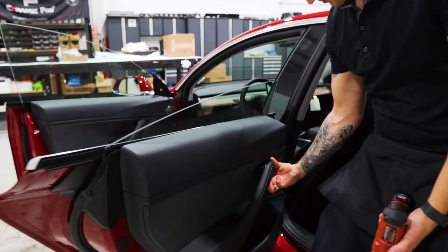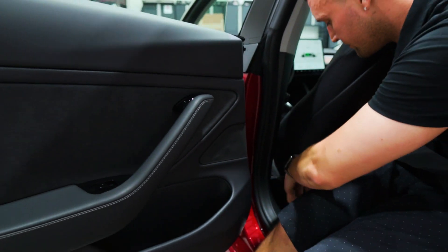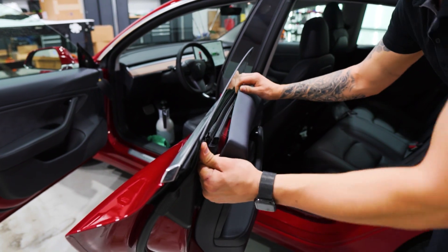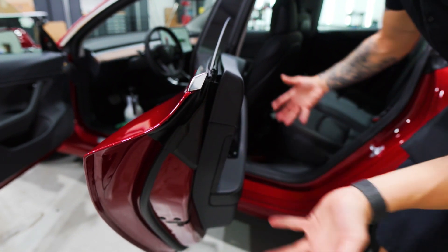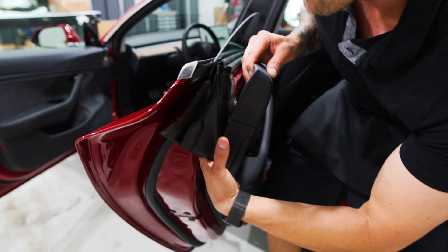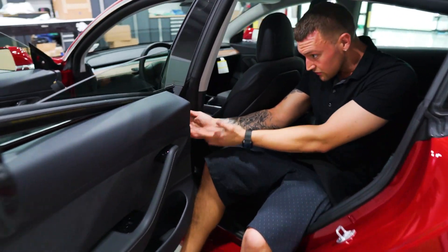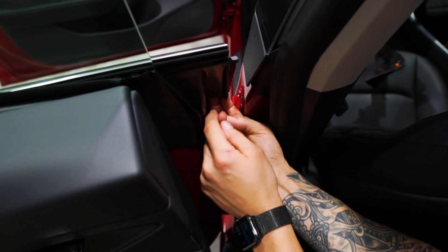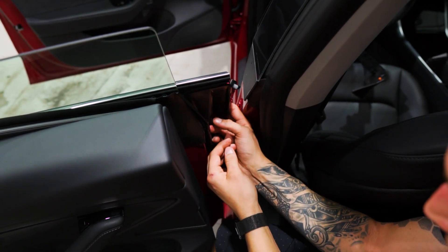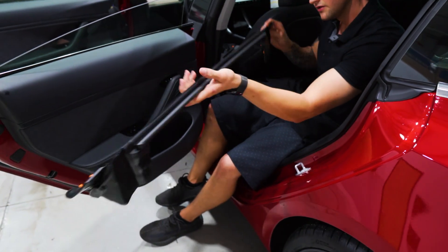Roll the window up and do the same thing to the back door. Roll the window down again, grab that piece of plastic, put it to the side, take the T25 out. The back door is a little different — it has these black pieces of plastic with clips on both sides, not just the back. Take the back off first, work your way in, remove the one from behind the door panel, lift it up, then do the same on the other side. Release the one behind the panel, lift up, and you have one single piece very easily removed.